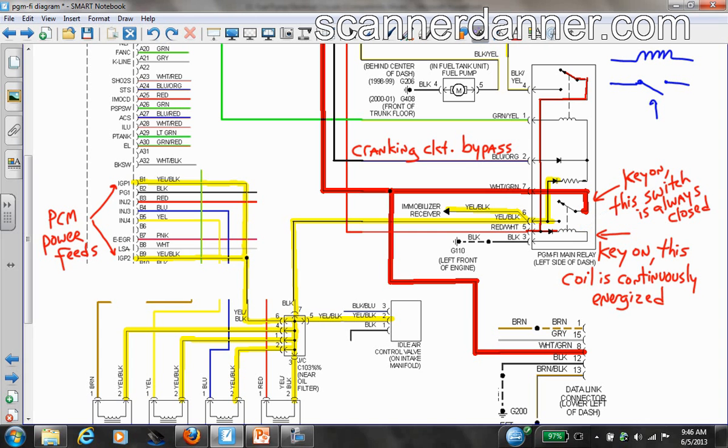On this one it's easy — we can see a ground right here. So what does that make the other side of the coil? It's a constant ground. That means the red-white wire on this side of the coil is a power feed — we don't have to go further into the diagram to confirm that. That fundamental piece of information — power and ground for a coil — tells us the red-white wire must be a switched power feed to energize that coil.